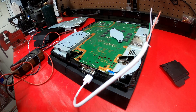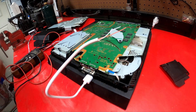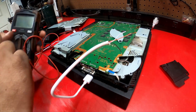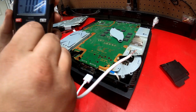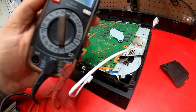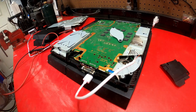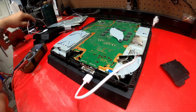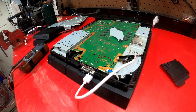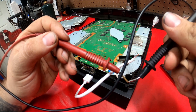You're probably wondering how we're going to figure out what pin to put these on. I'm going to use the end of this and take my multimeter. I'm going to set it to Continuity — see that? How that works is when I touch the prongs together it makes a sound.